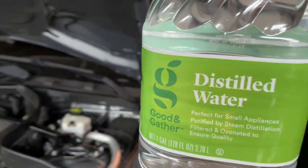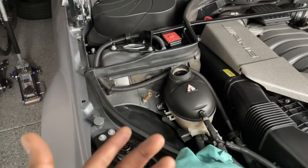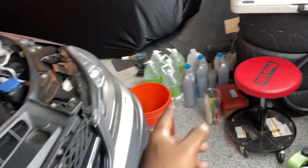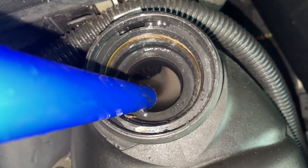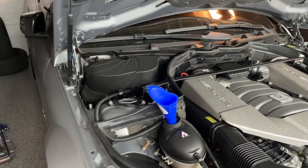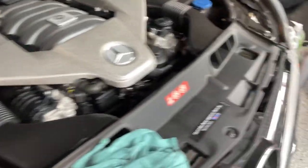Use distilled water only — not mineral water, which can damage your cooling system and cause calcium buildup. Distilled water has no ions so it won't cause any bad reactions inside your system. Once we get all the coolant out, fill the rest up with distilled water to flush out the remaining old coolant. When the fluid coming out of the radiator looks clear, we'll be good to add the actual coolant we want. I had about a gallon and a quarter to a gallon and a half of distilled water to get almost a full reservoir. Now we start the car, bring the heat up to about 80–85 degrees Celsius, at which point the thermostat opens and the distilled water and old coolant will circulate through the system.